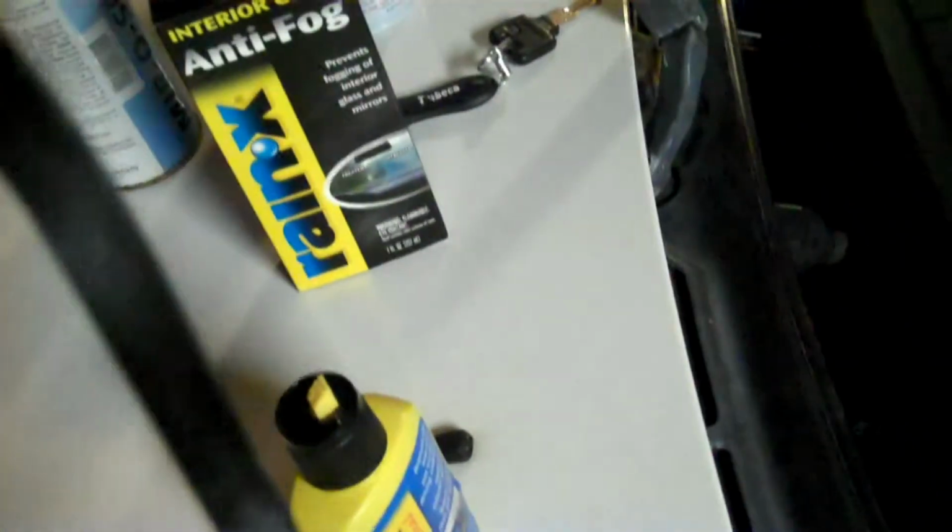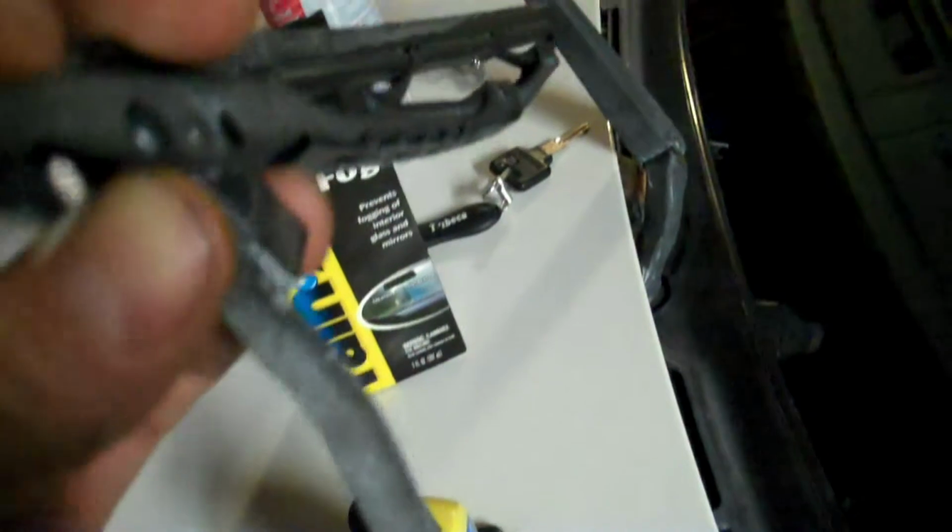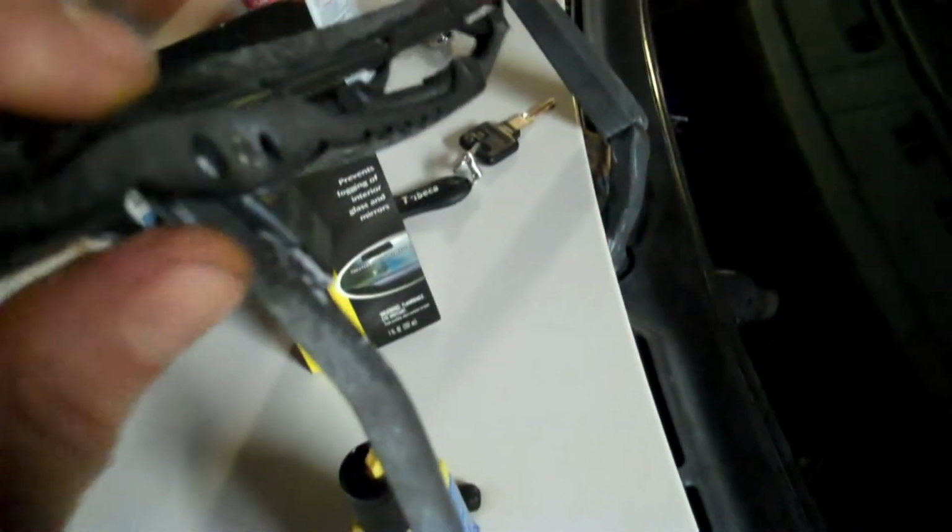Now, what we have is the way these things clip onto the wiper arm. These handy little Subaru ones here sometimes don't really want to fit, which makes this case the 2% of cars that it doesn't fit onto right away. Alright, to remove our wiper blade, I'm going to pull back on this little tab here, and this guy should just slide right off of there. And push down on it actually, and just slide that off, like so.